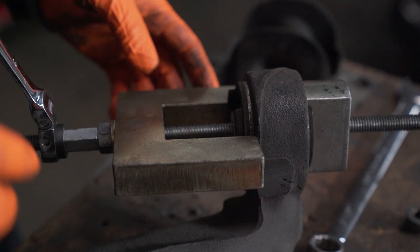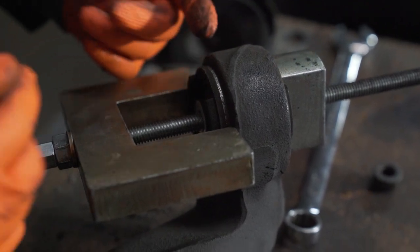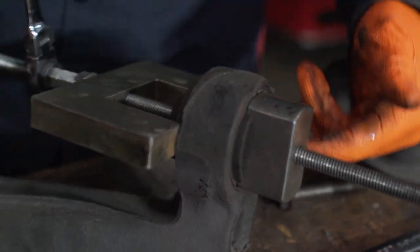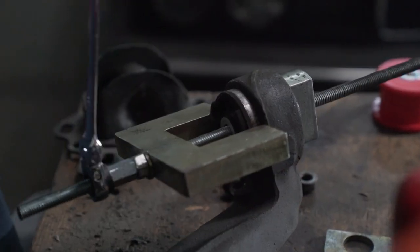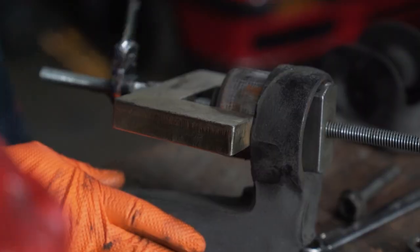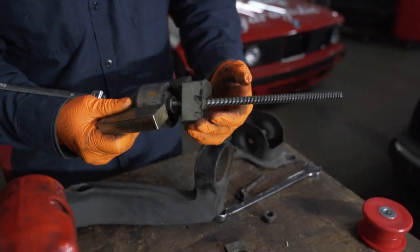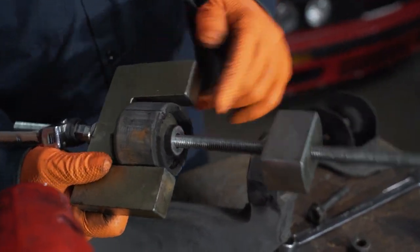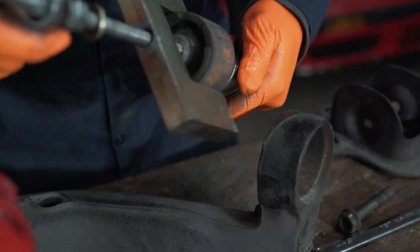The way it works is this U-shaped metal piece lines up on the outer edge of the trailing arm, allowing the bushing to get pressed into it. The outer piece is just small enough to fit inside the actual trailing arm inside diameter. The tool has a countersink that lines up on the race of the actual bushing, so you can be guaranteed it's centered to the inside diameter of the trailing arm — that's a nice touch.